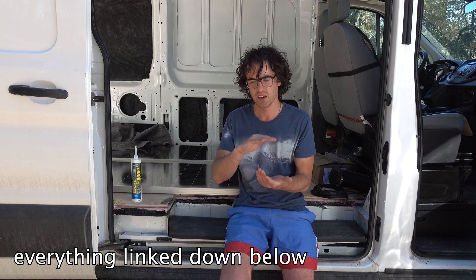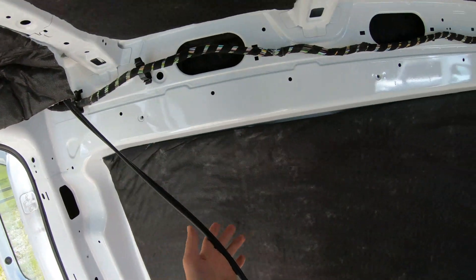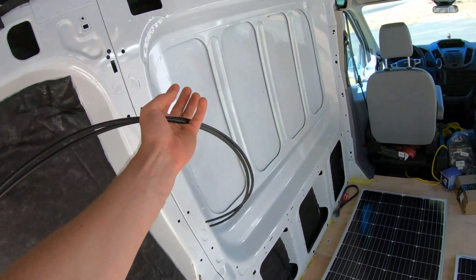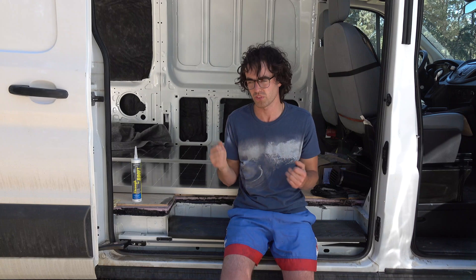I ran the cables through, put a bunch of butyl tape on the edges, screwed that down so it was as tight and flat as it can be with no gaps, and then put roof sealant — for use on roofs with leaks or places where water might come through — all around the screw heads and all around the edges, making sure that from the surface of the van roof to the plastic is unbroken and there's enough sealant to cover all of that. The next step will be to order 20-foot solar cables instead of the 10-foot ones I have, run those through the valves, and once the solar panels are attached and everything is set, I'll seal around the entrance port for the cables as well. If they short I'll have to redo the whole thing — but that won't happen, I hope.